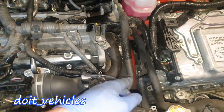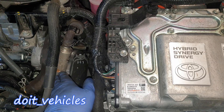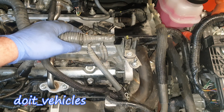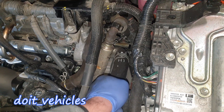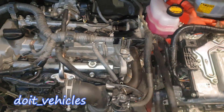And this is not the only one — we've got a second heat exchanger right here, installed on this PCV hose. The blow-by gases from combustion travel up to the valve cover, and those hot gases travel through this hose past this coolant heat exchanger. Again, that's how the coolant gets warmed up faster.